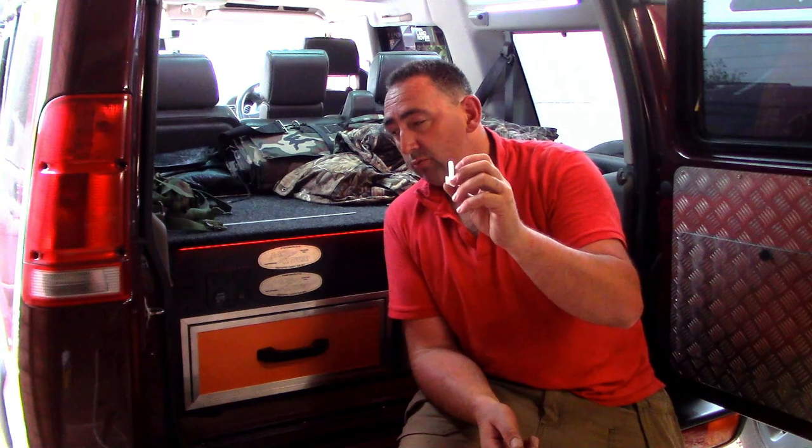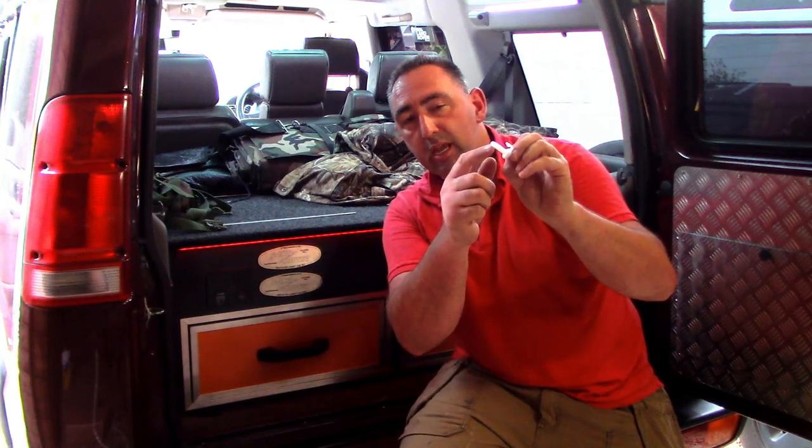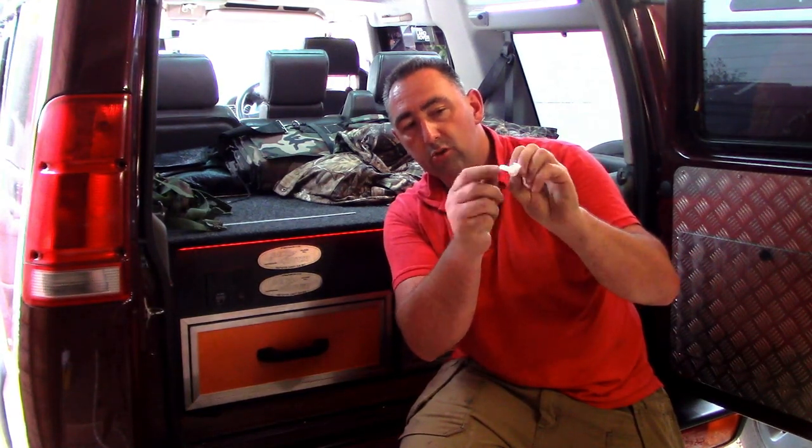I have had to repair both of my sunroofs because the drain outlets are only thin plastic, and with the vibration they snap. So yeah, and these are perfect. If you trim off the tapered piece at the end and cut them just off of the shoulder, they are hollow. And they are absolutely perfect for sliding down the center of the old one and epoxying in to repair it rather than having to buy a new one. So definitely keep hold of these, they're worth keeping hold of.